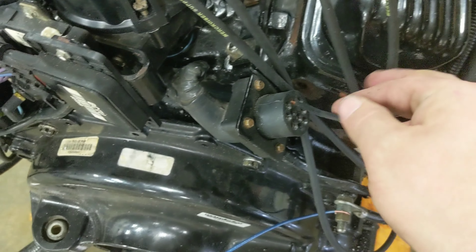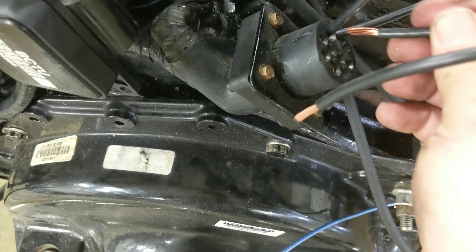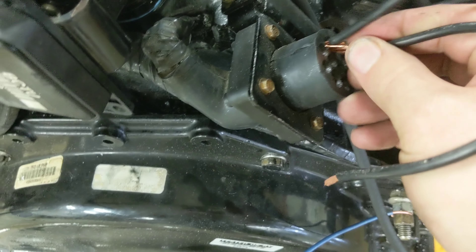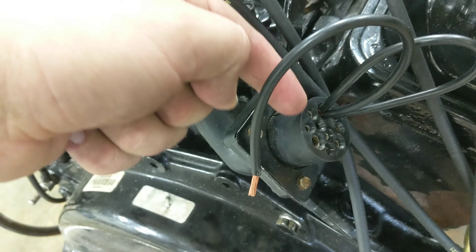The posts you need are five to six turns on the ignition. Here's five — this one's five and this one's six, and they've got little numbers on them. Then you also need to start the engine. This one goes to six, and I'm just going to sneak it in here. So we've got five to six — or six to five, sorry — and then six to seven, and seven will be the start.